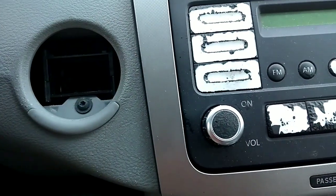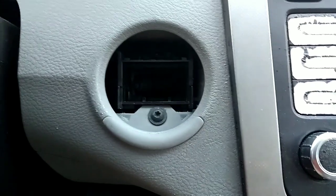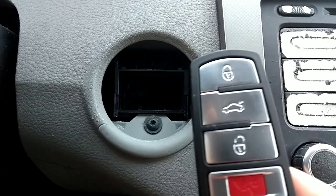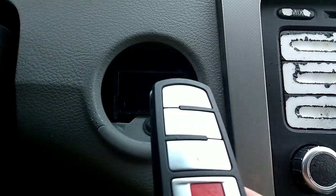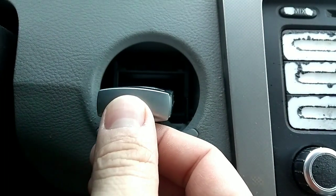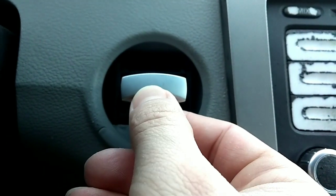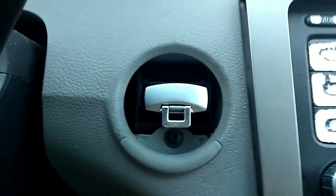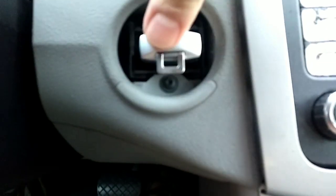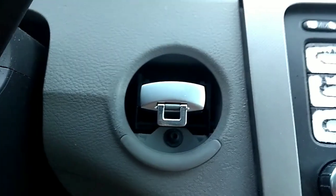This is the immobilizer ignition switch. When you put the key in — and this key has had the immobilizer chip removed, that little grain-of-rice-sized chip is now in the fob — when you go to put that in the car, it will give you a message like 'immobilizer active.' If you go to try to start the car, the car doesn't start, and the key gets stuck.